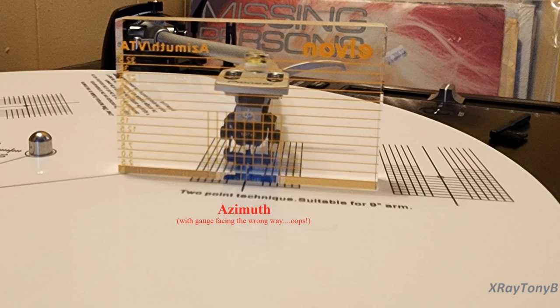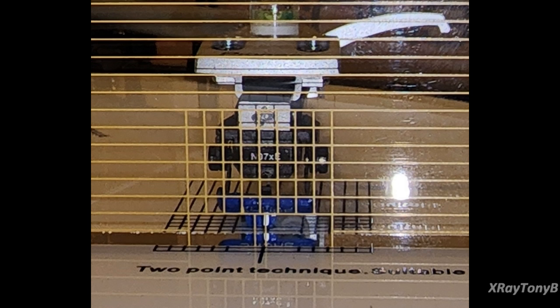Adjusting the stylus to be perpendicular to the groove is called azimuth adjustment. What you're looking at here is an azimuth adjustment tool — just an acrylic block with some lines on it. You can sight it like this to look at the stylus and cartridge with respect to the block gauge to help you align it. If you had to make this adjustment, you would either rotate the head shell with respect to the tone arm or put shims under the cartridge mounting screws. Normally this is pretty much pre-aligned at the factory and you don't have to mess with it very much.